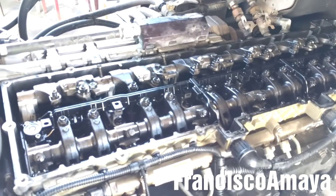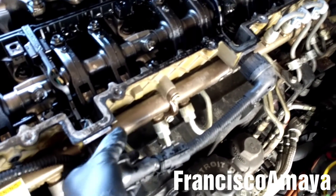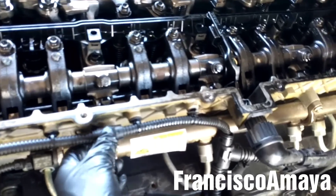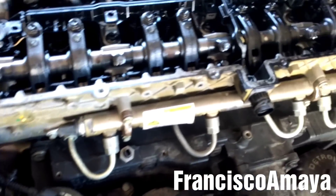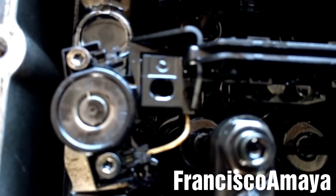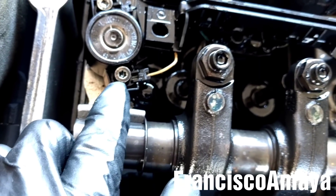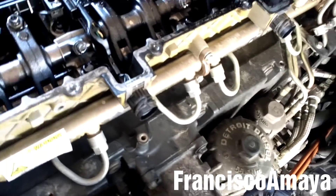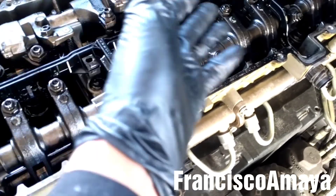The first thing I'm going to do to remove the cam housing is to remove these electric plugs — the injector electric plugs — and this wiring here from the cam housing. All the electric plugs are completely removed. The next step is to remove the injector harness. I'm going to remove these 5 millimeter bolts and this T25 for the j-brakes and the injector, then take this clip out to remove the injector harness completely from the housing.